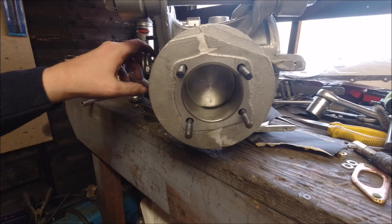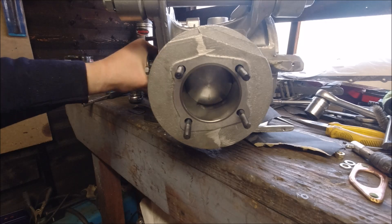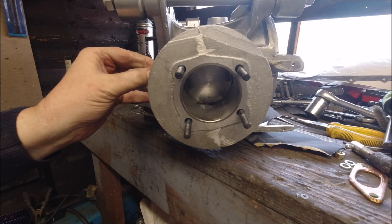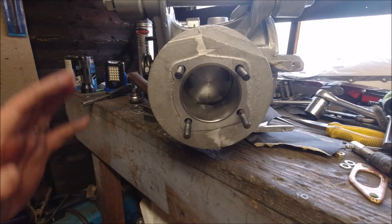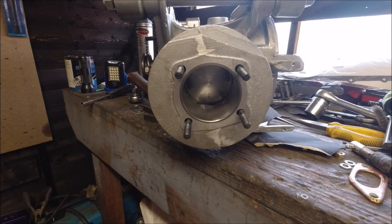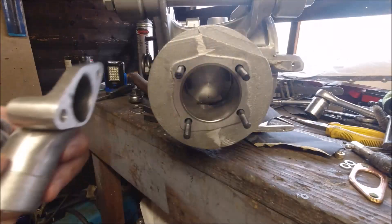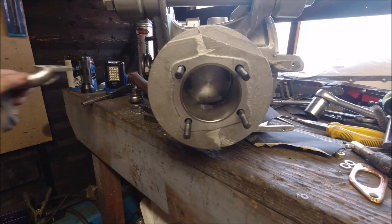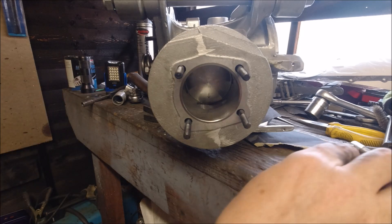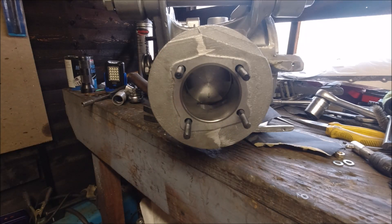Looking at the transfer ports, I don't know if this is based on an SR kit because the ports are slightly mismatched. I don't know how thick the aluminium jacket is around the centre bore, so I don't know how much I can drop these down. The last thing I wanted to do was put a hole in it, so I erred on the side of caution and just cleaned up the ports and the inlet manifold. The exhaust manifold is quite big — 42 mil Clubman size — so with a 22 mil on it, it should go okay.